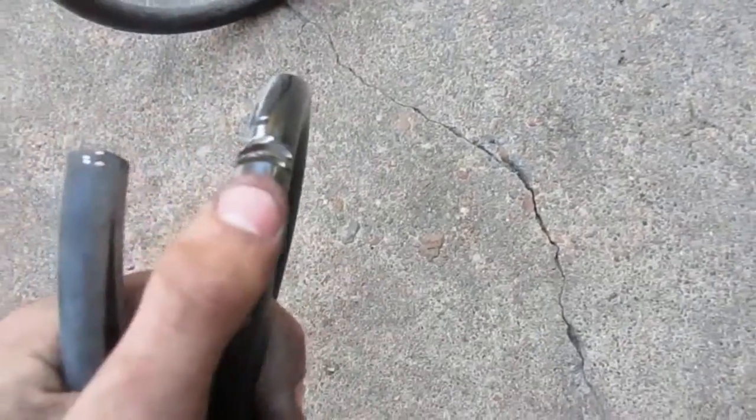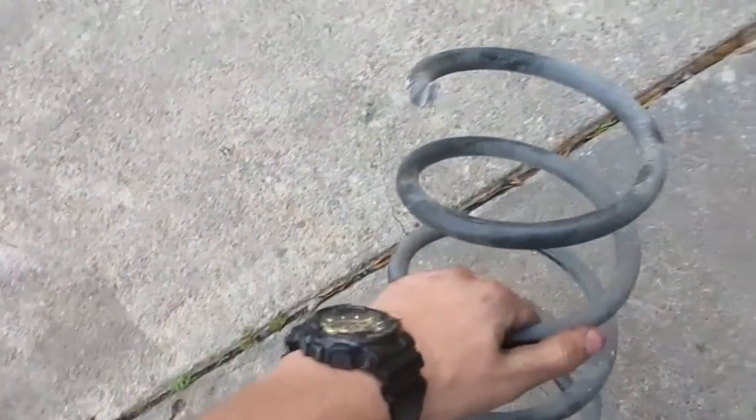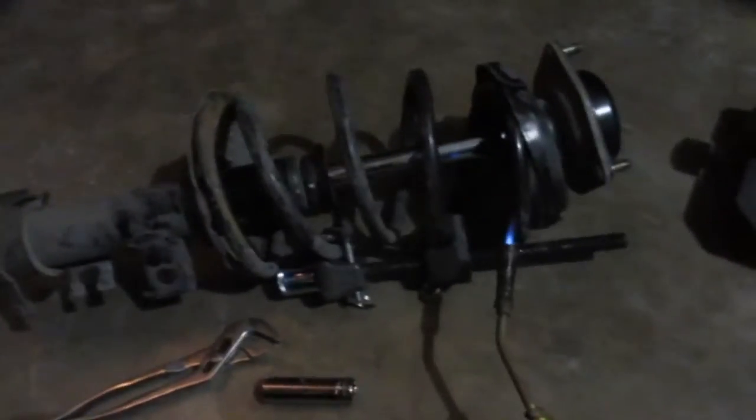I had it pointing down and cut straight. In order to cut it I had to cut into the top coil, but that's not a problem. Try to cut into the top one, not the bottom one - or a reciprocating saw would be better, but I just have an angle grinder, the Harbor Freight special. Now we're going to set that back in the strut, throw away the cut piece, put it back on the car, and do the other side.